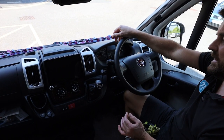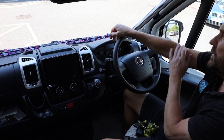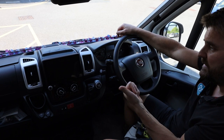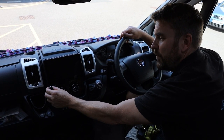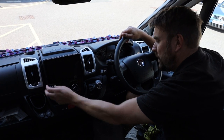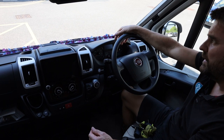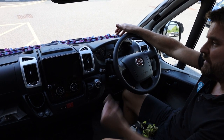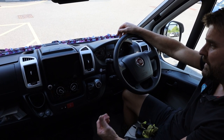The other thing is because it had a VP1 radio in there, that features one of the newer Fiat rectangular plugs with CAN bus data in and other stuff, which means that things like the rotary volume won't work. Now, we always run by the customer what it can and can't do, so that they can make a decision based on that. But the Pioneer is popular because it looks really good on the dash. It doesn't stick out like a sore thumb.